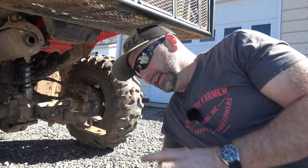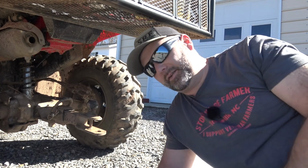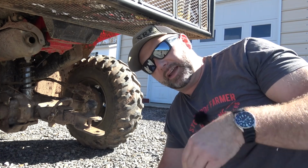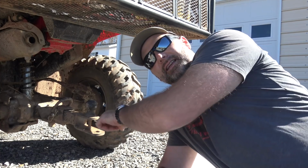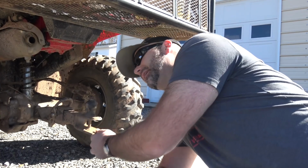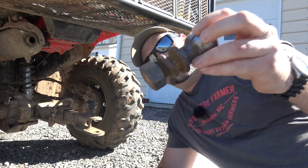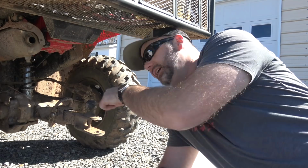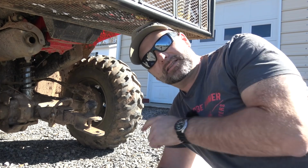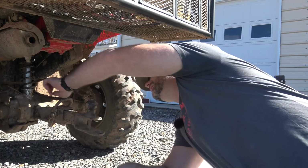I think the best place to welcome you is right under this ATV. I made a boo-boo, and my boo-boo was installing this receiver hitch on the back of my ATV. What this did, and you'll see in just a little bit when we start unrolling hay, we'll get a little footage of that, it made this thing a lever to do this. Bang, bang, bang, bang, bang. Twist the axle on the ATV. What I really needed to do was simply place a 2-inch ball on the hitch on the ATV. This was too much. This was overdoing it and stressing the axle and the ATV a whole lot. And I can see on my shock and strut back here, I've got a little bit of wear.